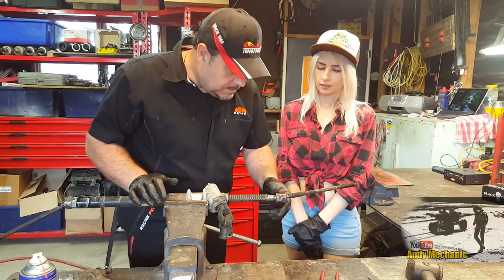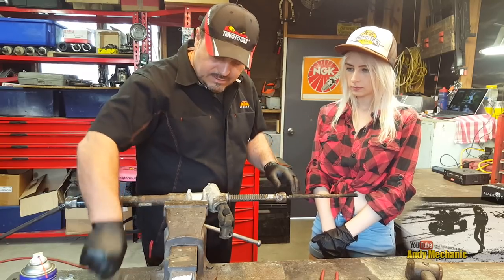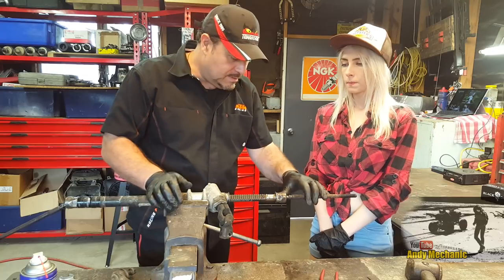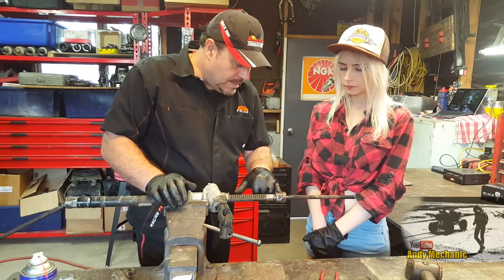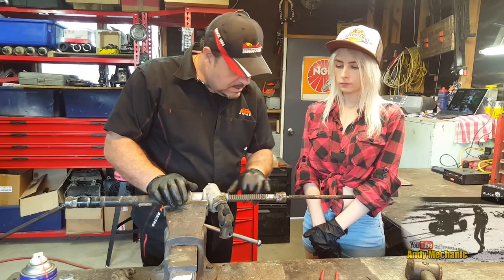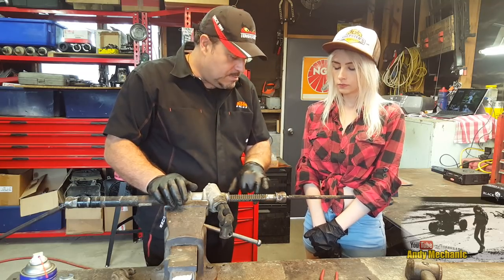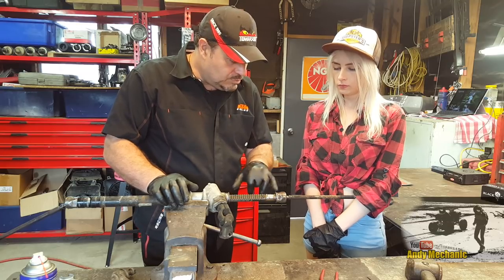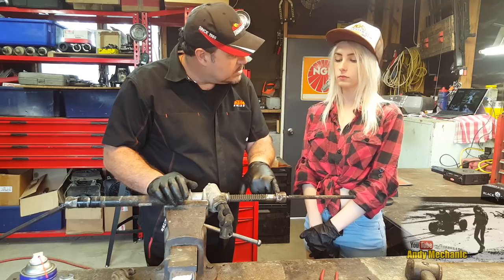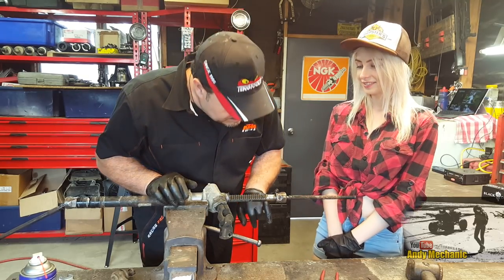Right. Now, this unit here, this part, can be purchased just like these from an aftermarket spares place. You don't have to buy a genuine Nissan. And that is held onto the rack. This is the actual rack, this bit. It's threaded in there. And obviously, being part of the steering system, it's really important that that never ever comes loose under normal use, otherwise one of your wheels wouldn't steer anymore. You'd probably end up in a ditch, I would say.